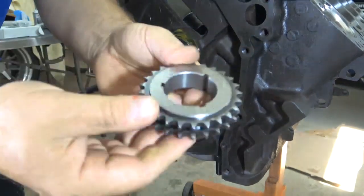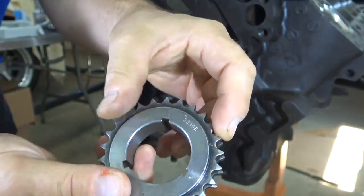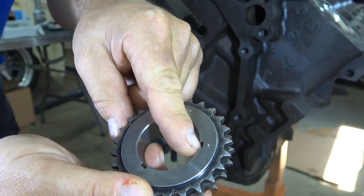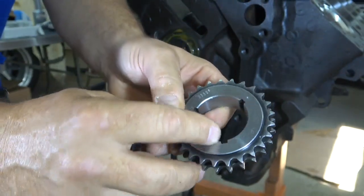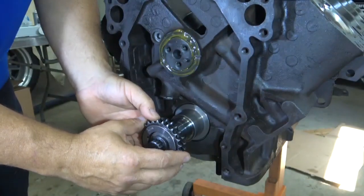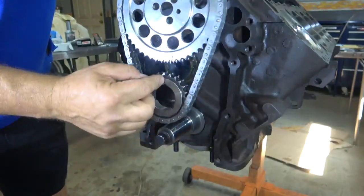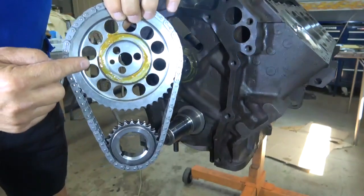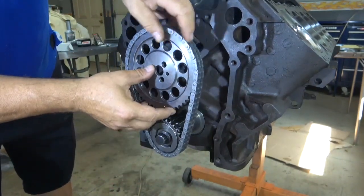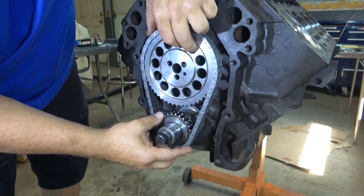I've got my key installed on the crankshaft and I'm quickly going to test fit the lower gear to make sure it's alright. This is going to be dot to dot on the gears. You can see on this sprocket there's a dot up here — this matches up with the upper gear, and the dot on the key way lines up with the key here. There are also two other positions: about four degrees retard or four degrees advanced. But I'm going dot to dot. There's also lube on the back of the cam gear because this is a thrust face against the block.